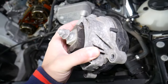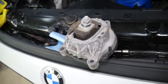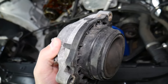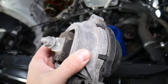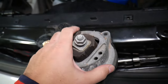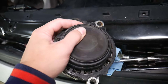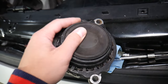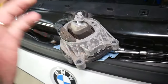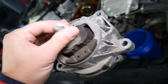About 90% of BMWs will have two engine mounts — one on the left, one on the right. They may look a little different depending on the engine type and vehicle, but they are a very important component. The engine mount keeps the engine in place and eliminates vibrations. It consists of rubber that the engine lays on, and most — even newer BMWs — are filled with oil. They're hydraulic mounts, so the oil catches fine vibrations, which is why some BMWs run so smoothly.